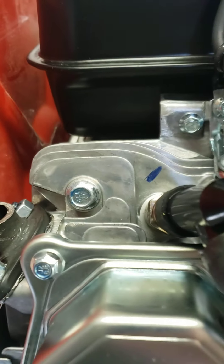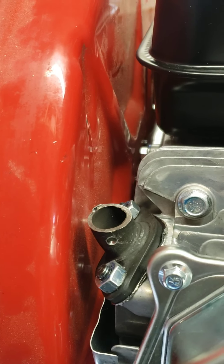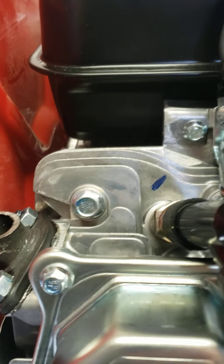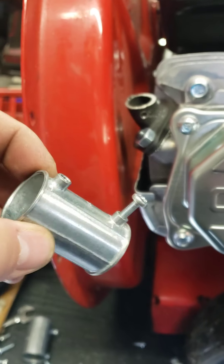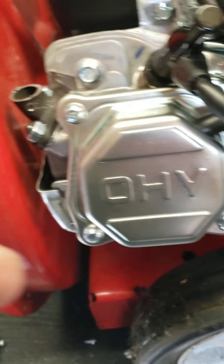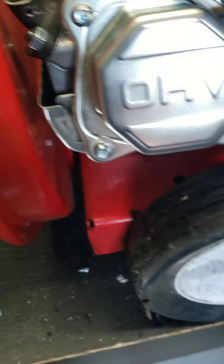I went out and I was trying to find some tubing or piping or something that I could fit, because there's not a lot of clearance right here, so we had to go up. What I decided to do was get some of these electrical fittings — it's a three-quarter — and I drilled the hole in it because I want that screw to go all the way through and lock in. I'm also going to use some high temp Loctite to make sure it doesn't come out.